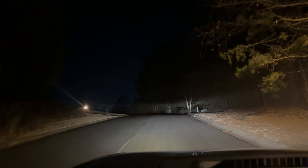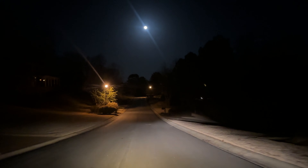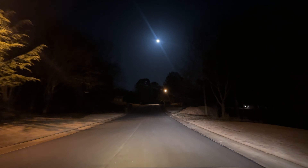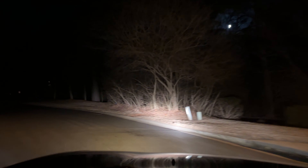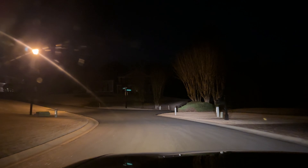Test driving the car now and initial impressions — it's looking a whole lot better. The lights are higher than before, which could just be how I had them set up incorrectly before. Looking at the cutoff beam going to the right side — that's the most important thing, because before when I had it aligned it was set left, and in the United States we need everything lighting up on the right. The light output looks about the same as before and I haven't made any headlight adjustments — I kind of like where it's at.